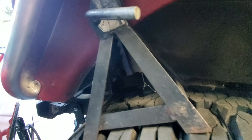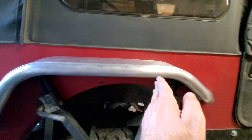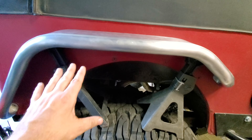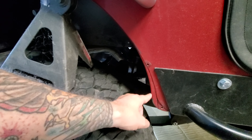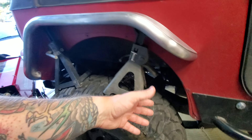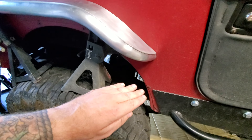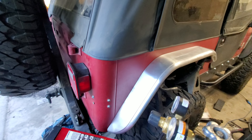Right now I'm trying to figure out exactly where to make the cuts and how to position this. You can see where we accidentally folded in the back, and now that the tire's sitting an inch further aft we're going to have to make some cuts. I'm trying to figure out how I like this to look, where the center is, and how to keep the cut round. We keep talking about lowering the Jeep two inches — I've made some lines here. The hard thing is you can't just cut right here because the tub is right there and it comes up at a weird angle. If I follow this line it's pretty close, and with the rear axle compressing on the shackle it'll move back slightly, so I think that'll work out.